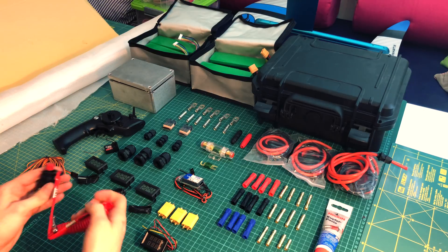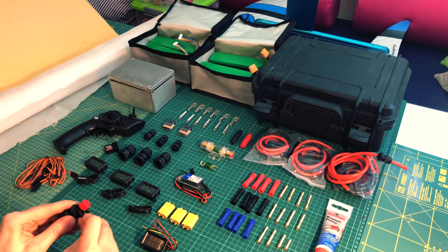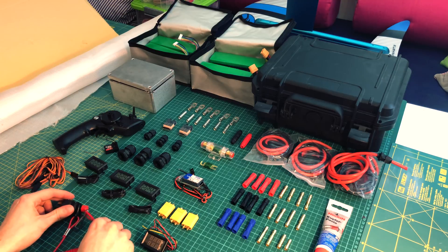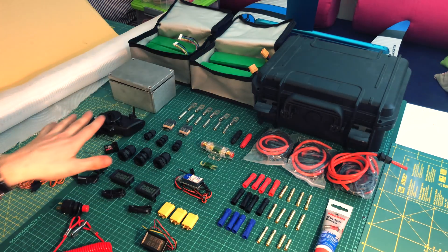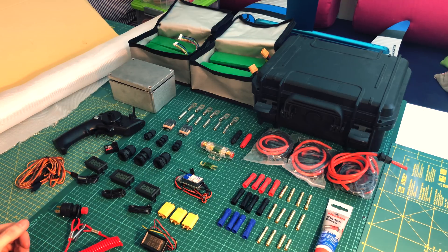This is a little safety switch like you have on a jet ski — if you fall, you pull this and it cuts the power, disconnecting the batteries from all the rest of the electronics. I have a bit of a problem here: I don't have a relay for that because relays are normally not rated for 200 amps. I can't find anything rated for 200 amps that's reasonably cheap — for $200 I can get one but that's too much. I might have to build one from a solenoid, or a friend from Hamburg is building one with 30 MOSFETs in parallel.